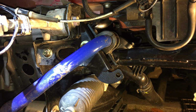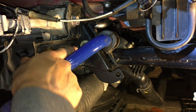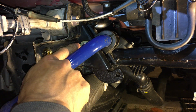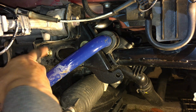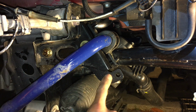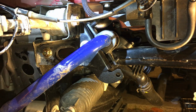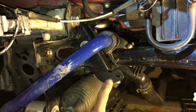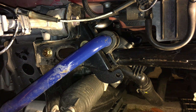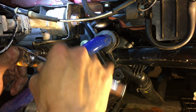Whew. And these two are pretty low. I think if I can remember right, this here was like 20 foot-pounds, but I wouldn't even go 20 foot-pounds with this one, because I mentioned in the previous video it threads right into the bracket, and this bracket's pretty thin. It's only 3/16, and I believe this is mild steel, so it's pretty soft. It's not like the nut. The nut is more hardened, so it's stronger, and it's also thicker too.